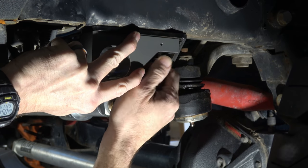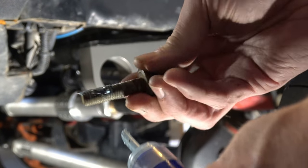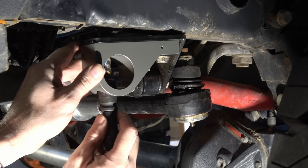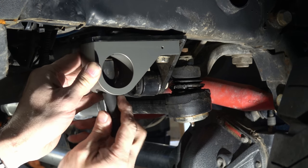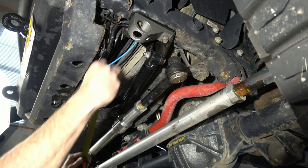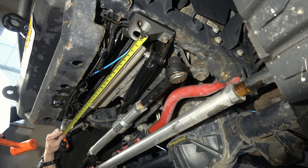So now I'm looking for the gray aluminum mounts to hold the frame bushings, and here they are already assembled. We are going to have to remove those little Zerk fittings and take out the bushings for this part of the install because we need that hole all the way through for the frame bolts. The front of my Jeep is to the left of the screen, so I'm installing the rear bolt first, then the front bolt.